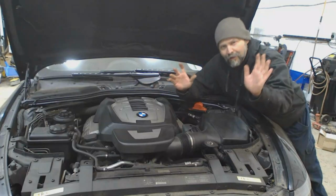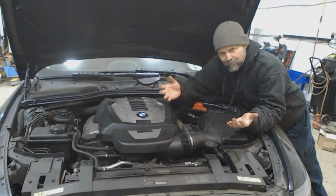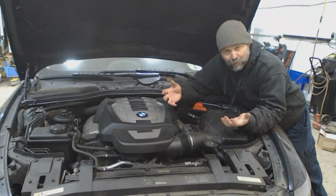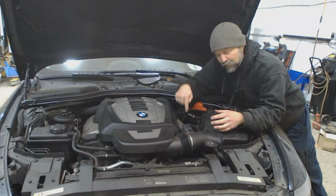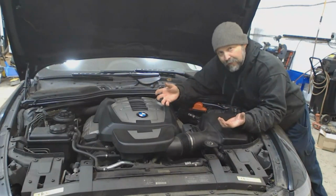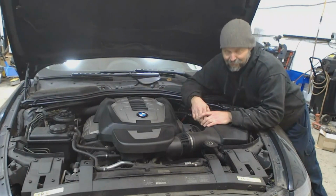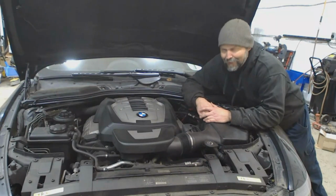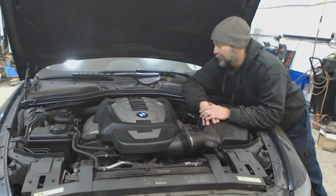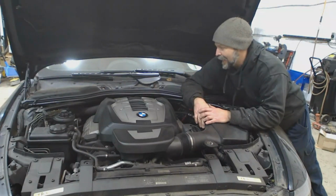And I'm also going to put in a 4L60. I know, okay. I bought a 4x4 4L60 because up here in New Brunswick, that is the most common thing. And I bought what I need to convert it back to two-wheel drive. But to do that, you have to take it all apart to change the output shaft in the back. So since I'm going to have it all apart for that, I am going to rebuild the old thing, and I am going to replace some of the known weaknesses in the 4L60. A properly built 4L60 can take quite a bit of horsepower, and like I said, I'm not going crazy, I'm just staying in the 400-ish range. So if you're interested in seeing that, I will also show you what I changed in that guy.